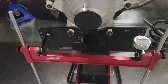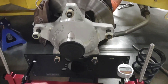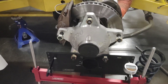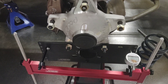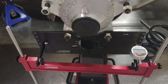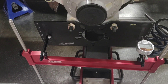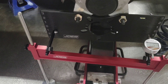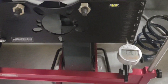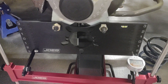Let's put it to work. When a car is traveling up you've got both the upper and lower A-arms plus the steer arm, and if it's not set up correctly it'll change the toe, which changes the way the car feels. This is a car that was brought to me and it is really messed up, so we'll watch it as it goes up. You can already see that negative number — that means it's towing itself in. At one inch it's at 60 thousandths, which is just over a sixteenth. At two inches we're at 100 thousandths. At four inches of travel at the wheel we are over 200 thousandths toed in. That is a massive number — that is nearly a quarter inch, over three-sixteenths and easing in on a quarter inch.